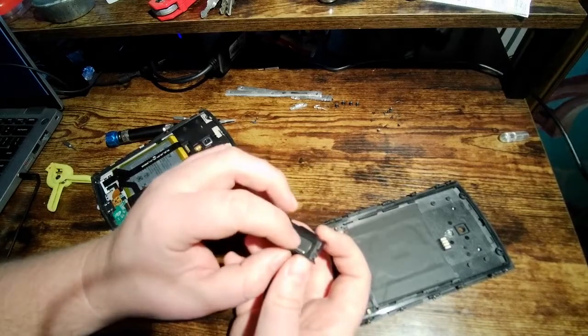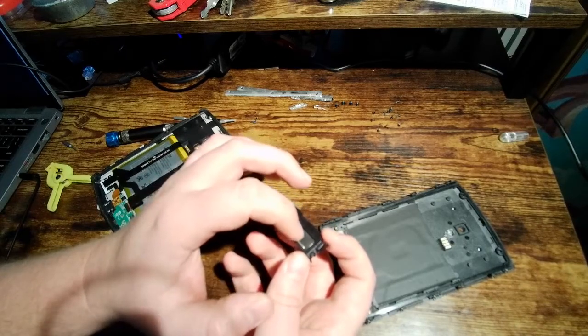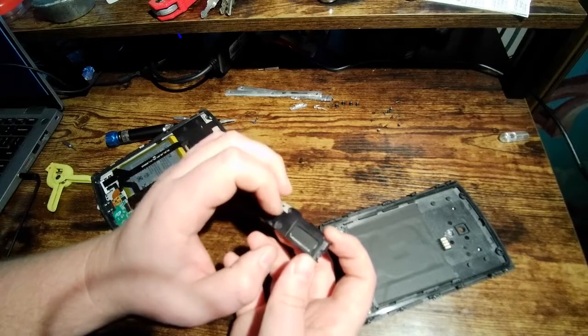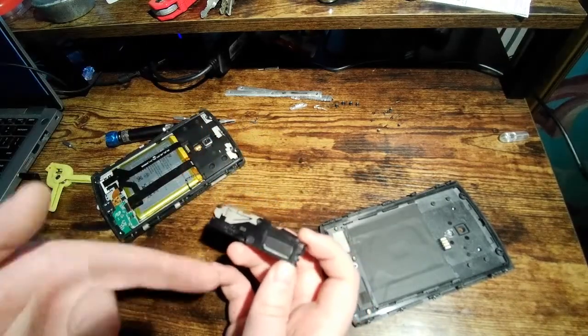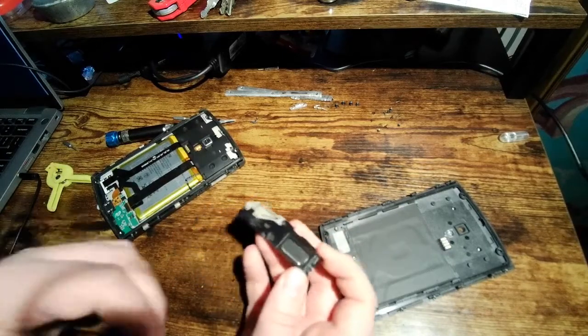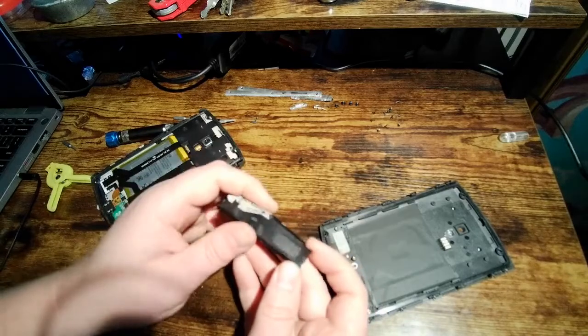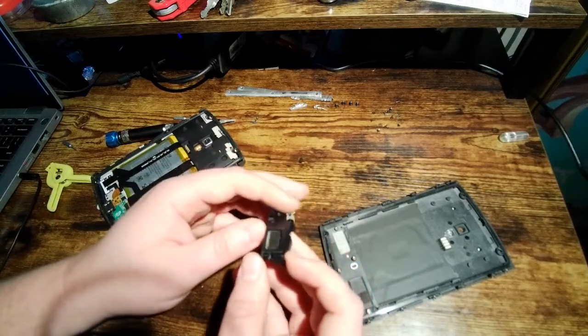You want to be careful when you're cleaning this, because this whole thing is sort of suspended. This is actually a diaphragm in here. You may not even want to touch this. What I usually do is I get a Q-tip and I clean it. I've done it fairly recently. Right now it's pretty clean. But I get a Q-tip and some alcohol and just kind of rub the surface of that. And you want to sort of look down in here and make sure there's no junk.